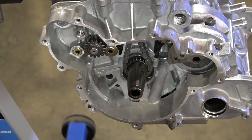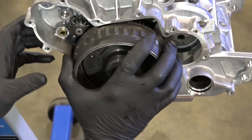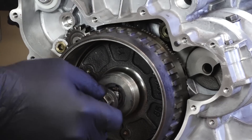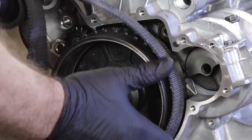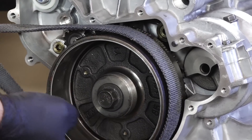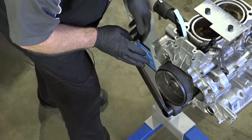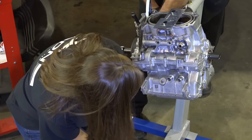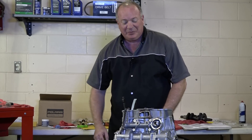Let's put a little dab of oil on the back side of where the taper is and get that flywheel on. Let's go ahead and get this flywheel bolt back on. What we're going to need to do is hold the flywheel still with a strap and then put 133 foot-pounds on it. Make sure it doesn't get caught up on the chain. About threw my shoulder out doing that.